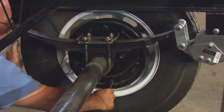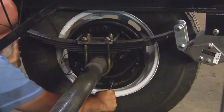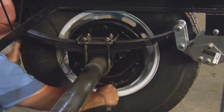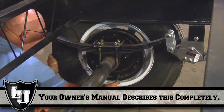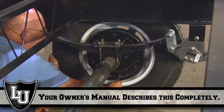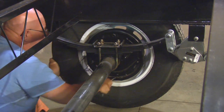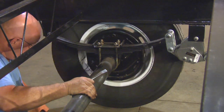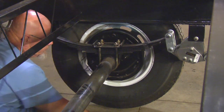He's adjusting the brake assembly out until that tire and wheel stops spinning. He's actually pushing the star wheel up — it's kind of like a teeter-totter: as he's pushing one end down, the other end goes up. There it's locked up. Now from there, we'll go the other way — one, two — and set it to five clicks, then roll the tire and see how that feels. You can hear a light drag, but the tire rolls freely. That would be a proper brake adjustment.